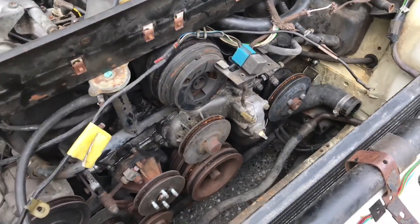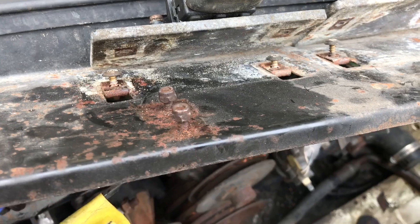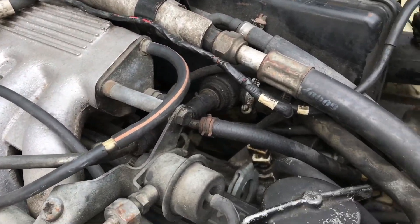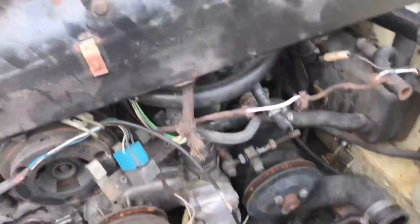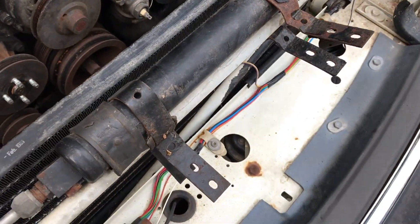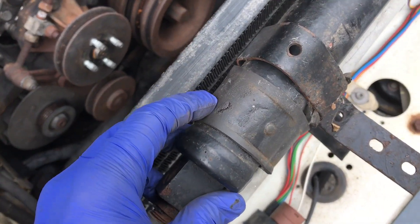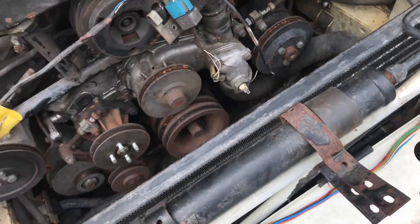Once you do that, you actually do have to remove the screws for the ignition modules here because they're joined by these brackets that go to the underside and plug in here. These are small Phillips screws — make sure you soak them all in WD-40. These go placed onto this condenser via a rubber insulator, this little rubber foam piece. You want to keep that intact and in place when removing it — just be careful.